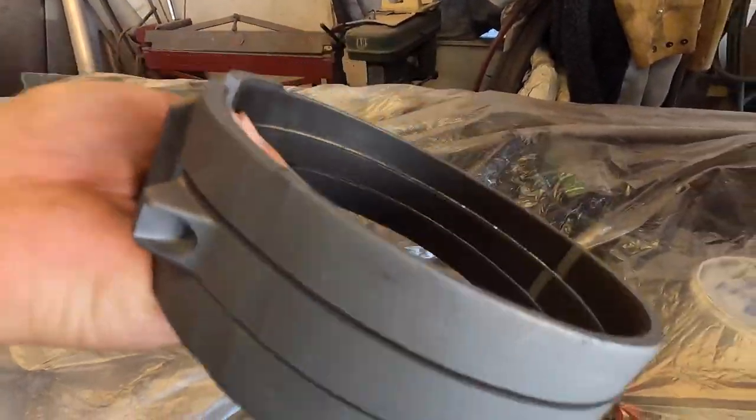We'll hook up old snake arm dial indicator and get a good measurement on the back. Let's start with that. I also got a new reverse band — if you watched the other video, I just slapped the old reverse band in there to check end plays, but it looks like it's kind of delaminating. I'll show you what that looks like, and I can show you what a good used clutch looks like versus a bad used clutch and why you'd want to replace them.